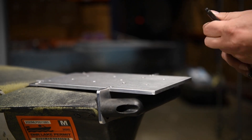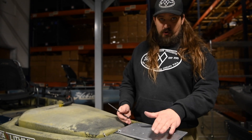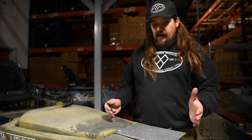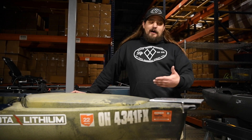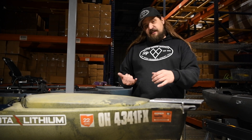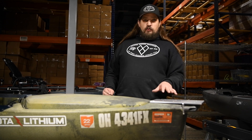And that's it. It also bears mentioning that these are brass fittings in the front, and if you ruin them, they are ruined forever unless you want to go out and buy a tap and try to re-tap them. Be careful when you install the handle bolts. We've got the mount installed and now it's ready for your bow propulsion motor — Guide or Minn Kota quick release systems. The square styles with the stainless steel u-bolt that locks it in place are going to work and be compatible with this setup, as well as our forthcoming quick release. We hope you enjoy your motorized Hobie — I know I have for the last couple of years — and I hope to see you guys out on the water. Tight lines.